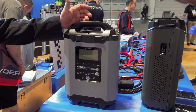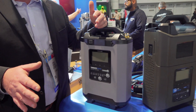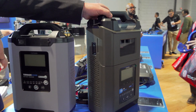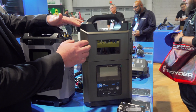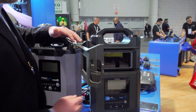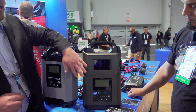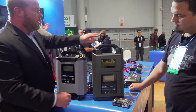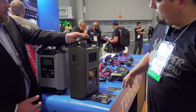And it looks like there's more on the way. So the T90,000 is a stable power supply to be able to produce 90 amps when you're doing programming or automotive diagnostics in any sense. But this guy right here is the next iteration of it. This is going to be a 100 amp unit, but it has something a little bit different going on up here at the top. So this has our R-Link built into it — this is a VCI that gives us the ability to do programming, J2534, with the power supply all built into one. So now you can use this as a J-Box and do your power supply all in one unit. You'll notice that the OBD2 comes out here — that's what plugs into the car side, and then we will power off of the car.